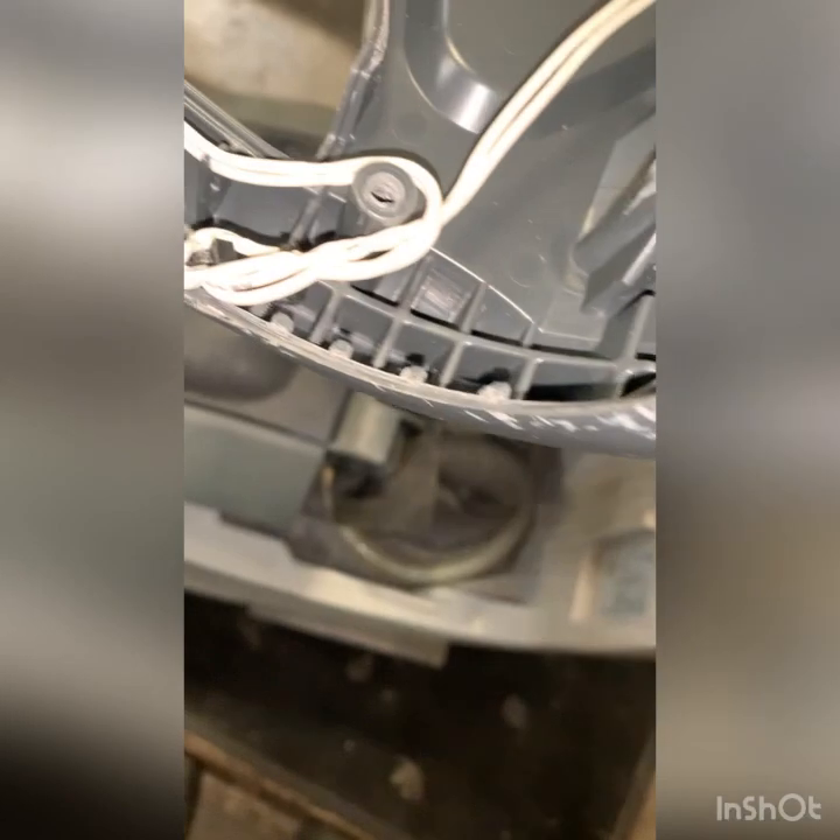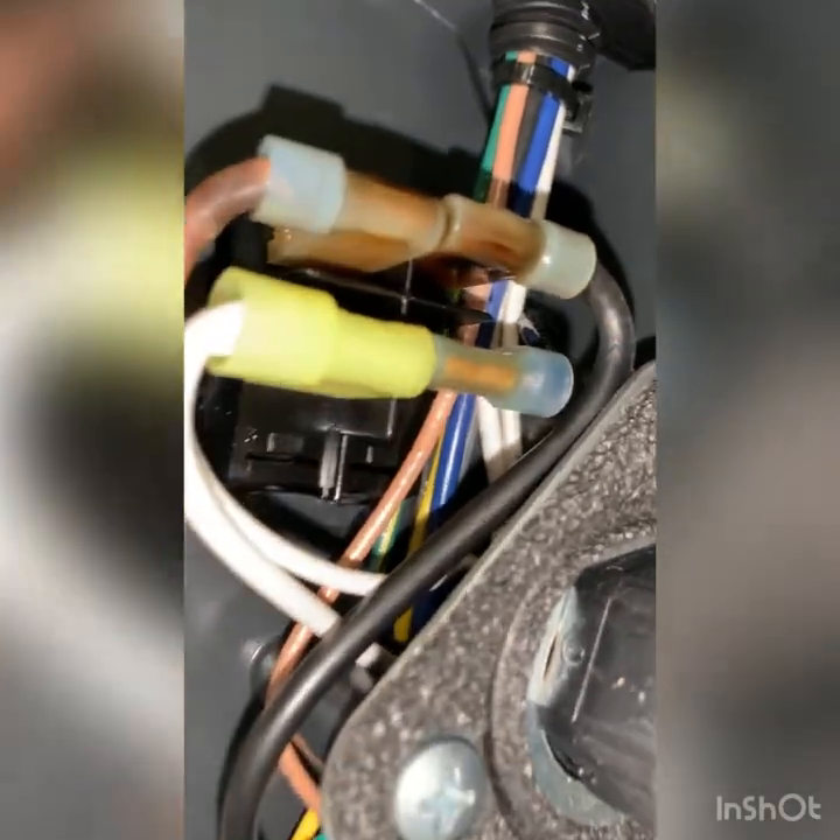I took the top cover off, and the source of some of the damage is shorted wiring — it's apparent. What basically happened is this overheated, though it's unknown as to why. We do have power switch damage here; this pigtail would have to be replaced. We really can't power any other devices on until this electrical issue is completely resolved — we have to replace this wiring.